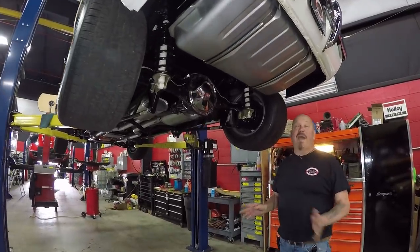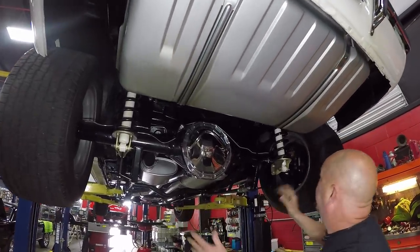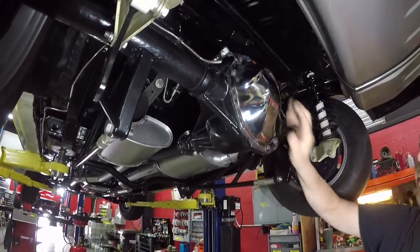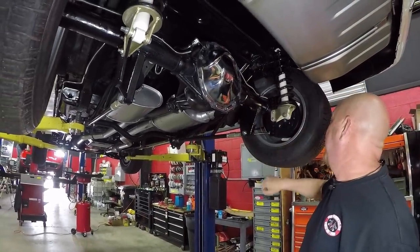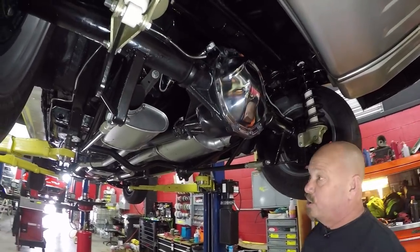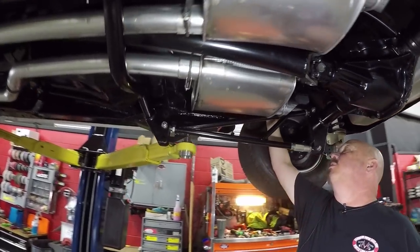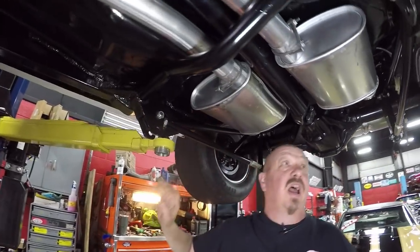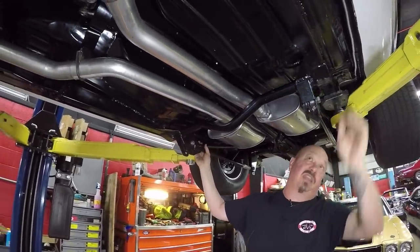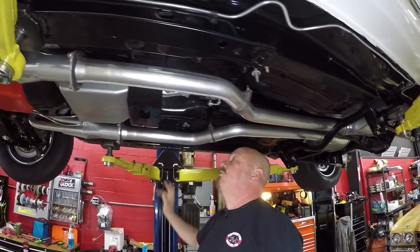All right, we're underneath this white Camaro and she's pretty under here too. That pinch weld looks good. That tank looks new, the straps are definitely new. It's got a ladder bar suspension with coilovers holding it up. Got a big panhard bar here holding it nice and straight. We've got right around a 3.08 gear in here. It is a 12-bolt — we rolled it over to count it and it is a posi. Looks like brand new brake lines. All brand new hardware on the brakes. They pull every set of brakes apart to make sure everything's in good working order. You can see it's been narrowed back here so you got plenty of room in the wheel wells. They've tied the frame — beautiful job tying the frame, got an extra cross member in here where the ladder bars hook in. Pinch weld looks good, floorboards look great, welded everything nice and tight.